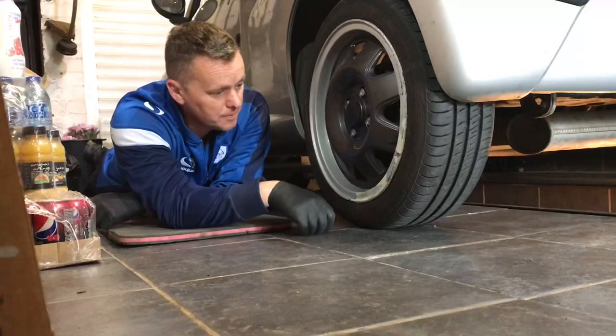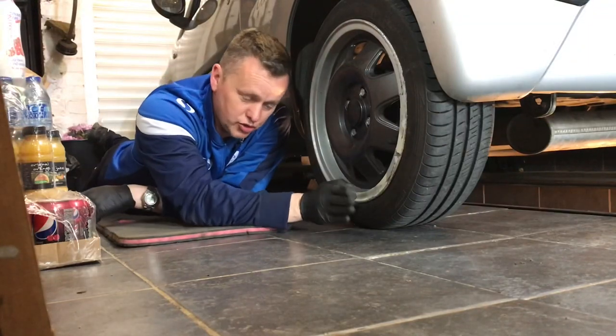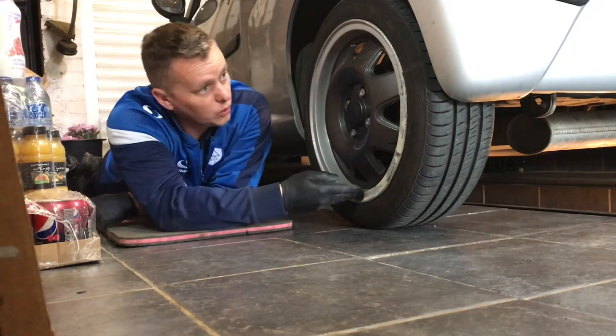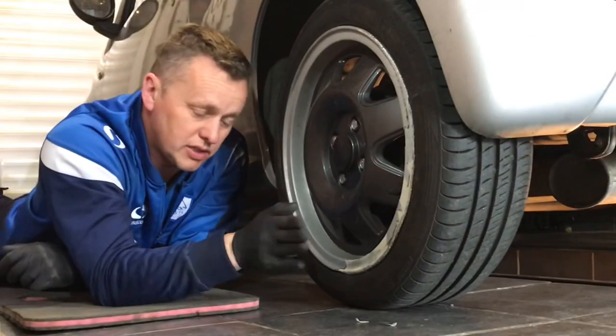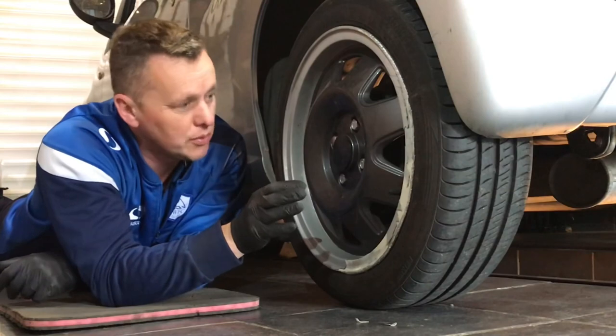On the impact, the back of the car drifted out on the wet road and took a right hit into the wheel. It's damaged all the wheel rim but worst of all it's actually shoved the suspension beam on the back — pushed it in. So I'm going to have to replace the beam on the car.